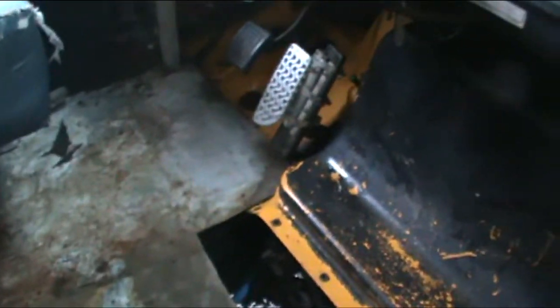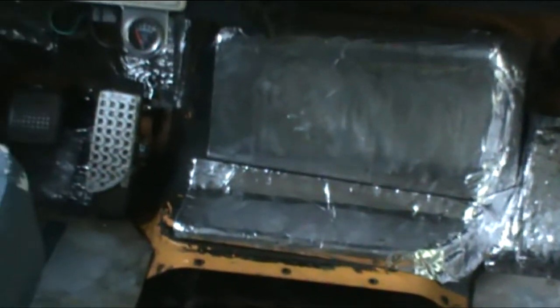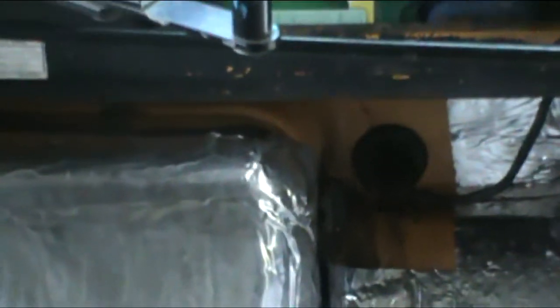Talk about ripping stuff out — I've pulled all the rubber mats down from the cab area here. I've got a bit of surface rust; it's not very bad down there, which is not a surprise because that's what the rest of the floor and the back look like. What I did was wire brushed it to get the rust off and then painted it. Here's what I've got so far — this is almost done, a couple of bare spots. That's around $100 worth, and I need quite a bit more. I've only done the interior.